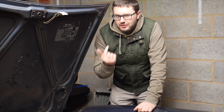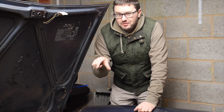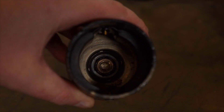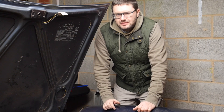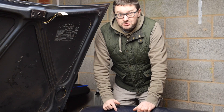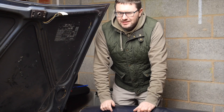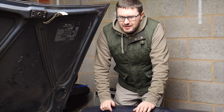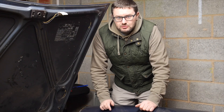So something is definitely worn inside my wiper motor — it could be a bearing at either end, possibly the bearing in the bottom of the body itself — and that basically means the wiper motor needs to be refurbished. I put in a couple of calls and found a few places that actually do refurbish these motors, and the prices were £200 plus VAT, so yeah, a little bit steep. So I called the guys at Classic Alfa; they said they had a wiper motor for my S3 Spider and it cost me about £110.